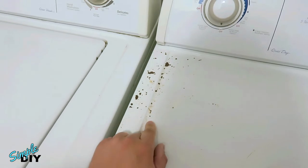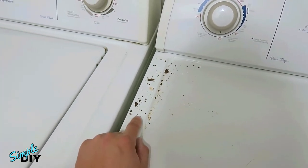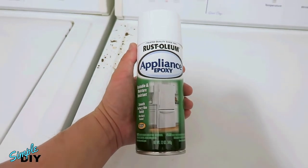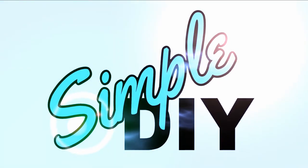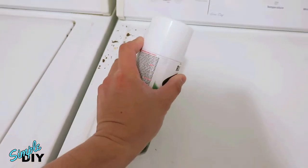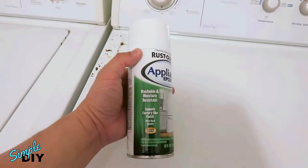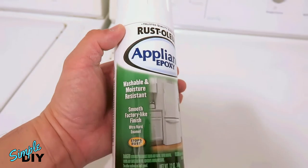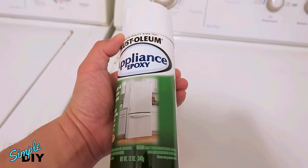To fix this you do need to repaint this surface. What I'll be using is a product from Rustoleum — this is Rustoleum Appliance Epoxy Paint. You can get this at most hardware stores. This one I have is the Gloss White. If you look on the label it tells you it's washable and moisture resistant, so it's perfect for a fridge or washer. This paint comes out a bit thicker than regular spray paint and also covers very well without using primer.